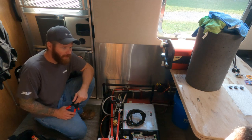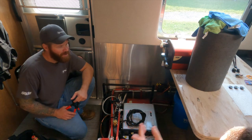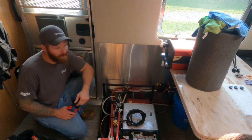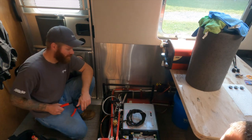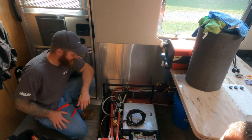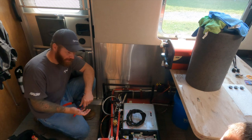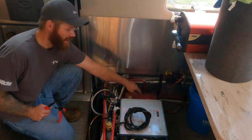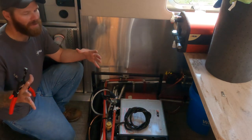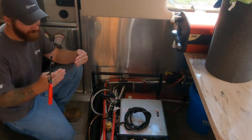I'm wondering if it's better just to leave the system running on propane while traveling. We have two gas-stop devices on it — though I wouldn't recommend running it unless you're using it. It's designed to be efficient, come online pretty quick, then shut off and cool correctly. The seam weld on this tank is where they're cracking, from the pressure that builds as well as the contraction — it's just splitting the weld.